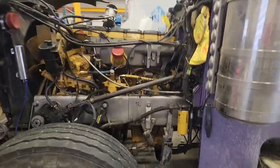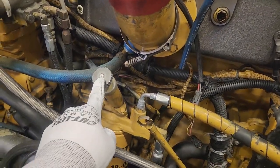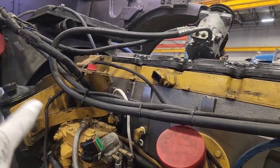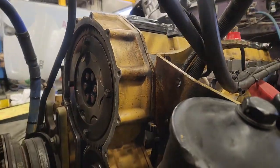Here's where we had left off, first thing Monday morning. Mostly it's together, and the head is not painted yet, but we do need to get the blow-by tube on. We've got the fuel system connected but we need to prime it. We need to get the alternator and AC compressor brackets back on, the power steering bracket back on — a whole bunch of little stuff.